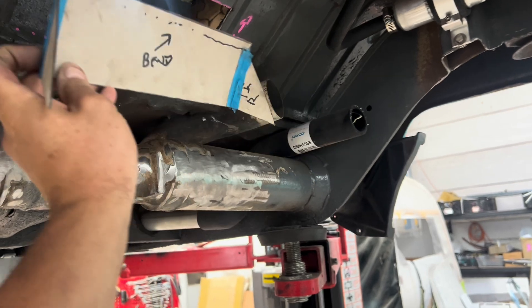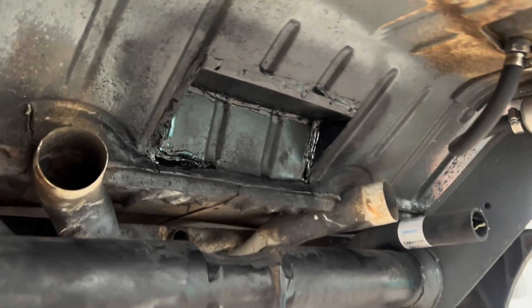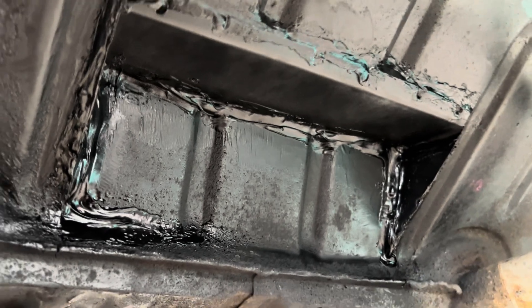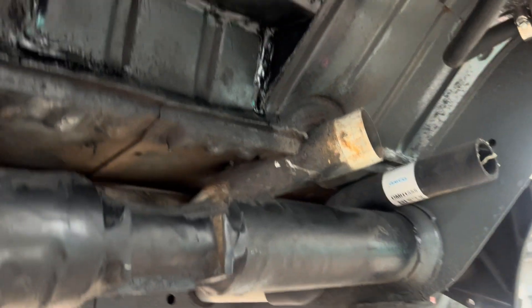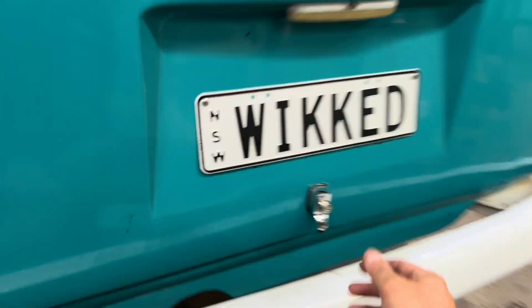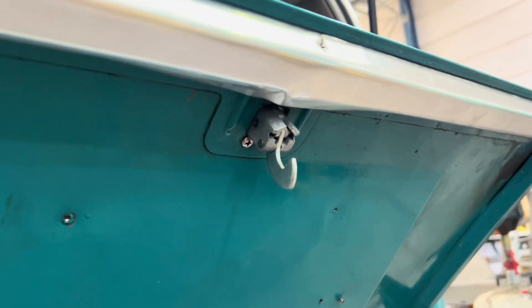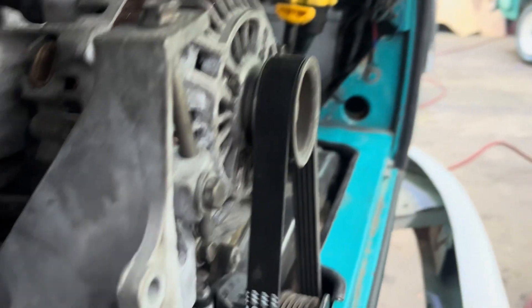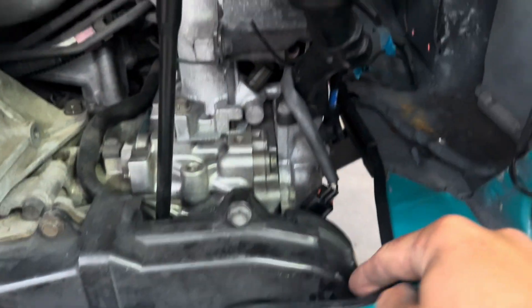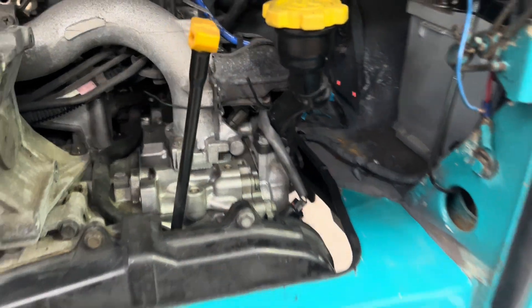So with the cover plate that we make up for the top, we've just made a cardboard template. You see where it's going to sit up in there, and then we'll make that out of sheet metal and weld it in there. That's the sheet metal plate that's been made up and all sealed - use polyurethane to seal it after it's been welded in. And then there's the mount. With the rear panel on this particular model splitty with that style latch, we made a little piece there for it to clip onto. It's all very tight but it does work. We just had to notch in around here, and there's a notch and cut here as well, and then also this part along here you have to clearance as well.